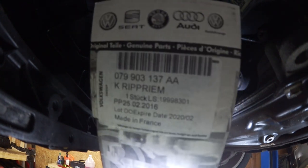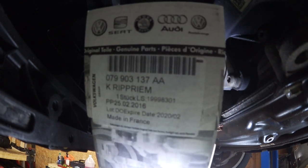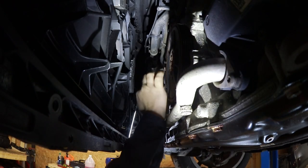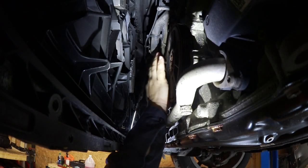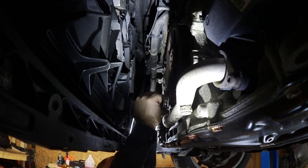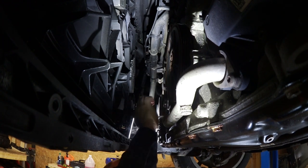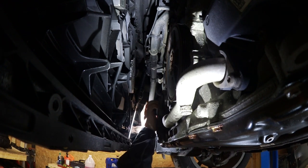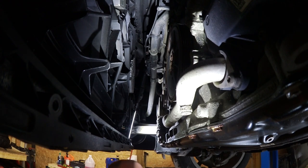There's the belt I'm using. I got it from a Volkswagen dealer but they were able to order the Audi belt. The idler's not squeaking. The tensioner is the same — it spins free, no squeaking. It's a good time to have a look at all the pulleys, the alternator, make sure all the grooves are nice and clean.